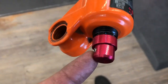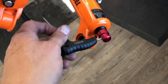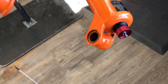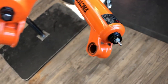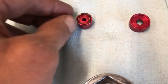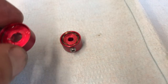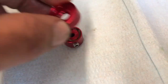This one had quite a bit of grease on the air shaft and the negative spring was pretty well fully compressed, so it took a bit to cycle it out to where we could remove the air shaft. It's a little 2 millimeter hex key to remove your rebound damper knobs. Just make sure — there's a little wavy washer between the outer ring that fits in just like so. Be mindful when you're taking that apart; that thing could just fall out on the ground and you'd never notice it.